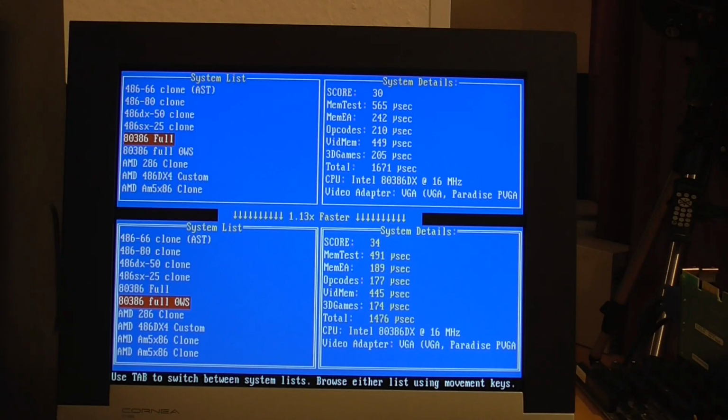And that's exactly what we'd expect, because that is a protected mode benchmark. And similarly, Doom is now at 8489 real ticks versus 10,349 that we had before. So that's also up 15-20%. So 0 wait states is definitely a success. I'm going to now try the 20 megahertz option and see whether we can get even more out of this system before I switch over the video card. You can see that the video RAM speed, of course, hasn't changed because I'm still using the same card.